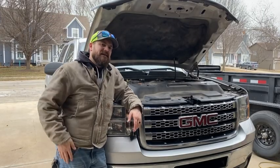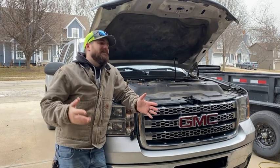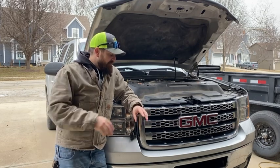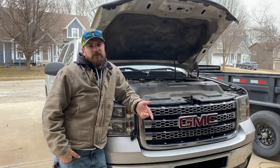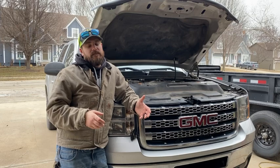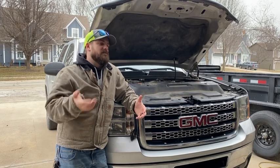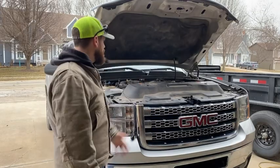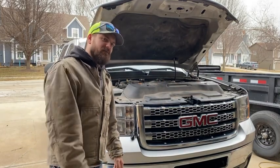There you go, that easy. That is definitely one of those things that you can do at home. I won't say I'm a great mechanic — I'm a decent mechanic, I know a little bit — but I'm not super knowledgeable about diesels. That being said, fuel filter, oil changes, things like that — don't be afraid. All you have to do with fuel filters is make sure that you get your O-rings on there, make sure they're seated properly, and make sure that you fill the fuel filter so that you don't have to reprime the system. Because if you get air in there, you're having a bad day. So it's that easy. If you guys want to see more on my service truck slash work rig, let me know. Until next time, have a great day.